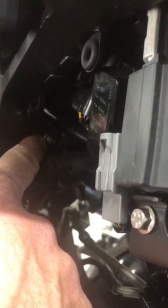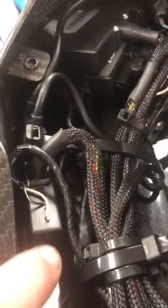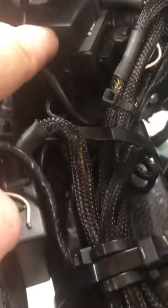Like any things that you put power commanders on, if it's attached to any of the panels or the fairings with plastic ties, make sure it's all off. I have a few bits, because it was one of the first models, or what was the first model, we didn't know. So I've got a power commander 5, ignition module, secondary fuel injection module, and a lot of wiring, unfortunately. I also have to disconnect a plug there which goes to the pump for my airbox cooler, because I've got that to cool the boost pressure down.